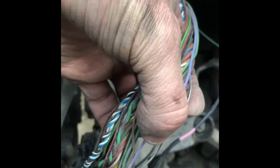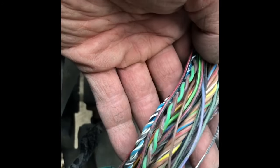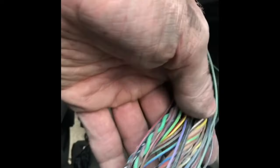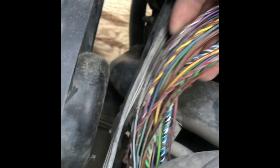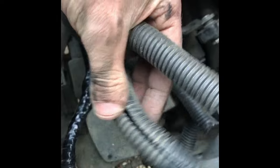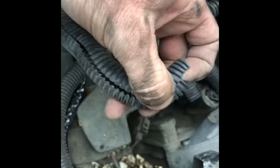I could cut the purple wire out and put a new piece in and heat shrink it, or I could just put a piece of electrical tape around it. I can also see over here this red-black wire is also chafing through — so this seems like a spot on this harness that is not very well protected from the loom itself. I put some new electrical tape on there. I also found some loom which is much, much softer — look at how easily it bends, it's just soft, it doesn't hurt my skin.